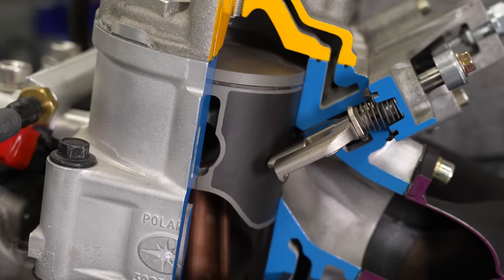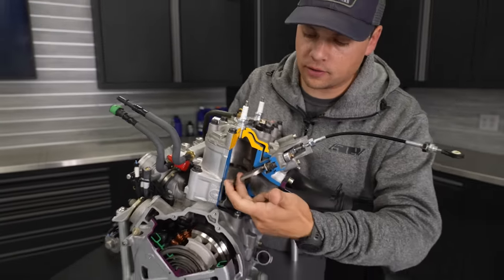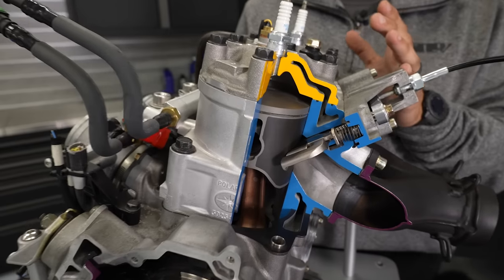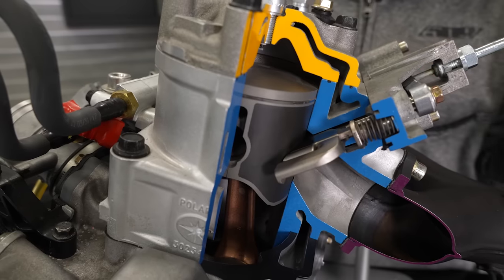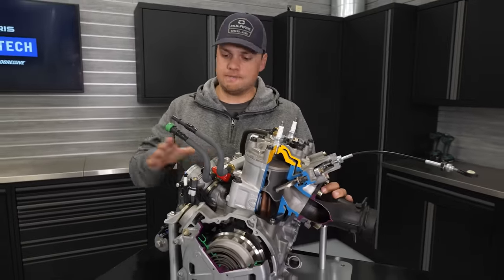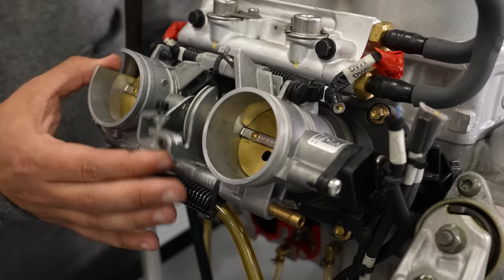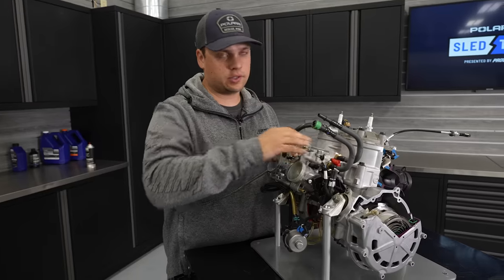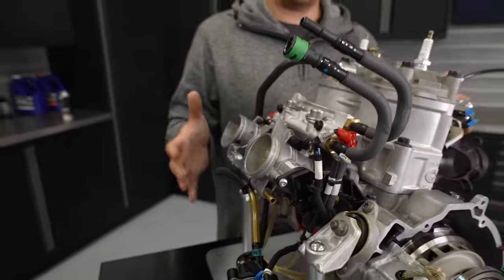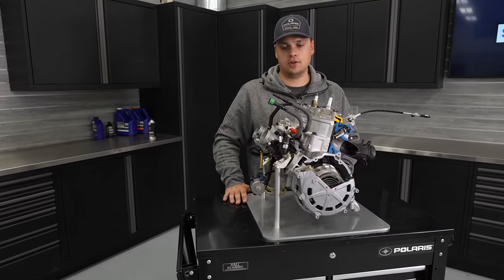It's got a three-stage VES system, very similar to what we've been running in the past with some cool upgrades. The exhaust valve is allowed to be tighter to the cylinder — look how tight that seal is there — and that makes more power. The design allows for more variation between the different stages, so we can do more with the exhaust valves, which is a really big part of making a lot of power. On the intake side, upgraded to a 50 millimeter throttle body. More power means more air, so a 50 millimeter throttle body with a largely similar SDI — semi-direct injection — system that we've been running on the 800 HO. Put it all together and it's a really strong platform that performs really well.